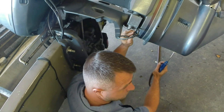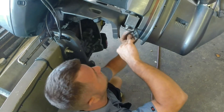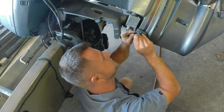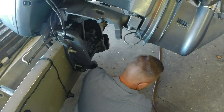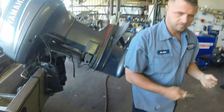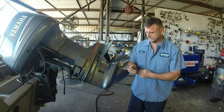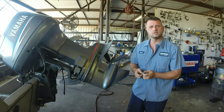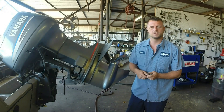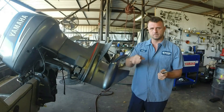Basically we can put air right at the nozzle and shoot out. You can see by the hair, we're clear — we're good to go. This speedometer is going to work. Connect it back up and now you have a working speedometer. This very simple fix doesn't take long at all, but if you know that then you can go ahead and solve most of your speedometer problems. Fix it right up while you're on the water and save yourself some money. Thank you.